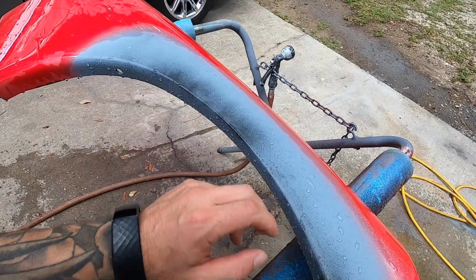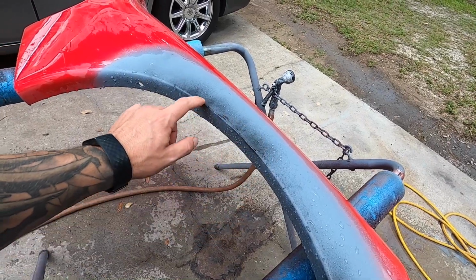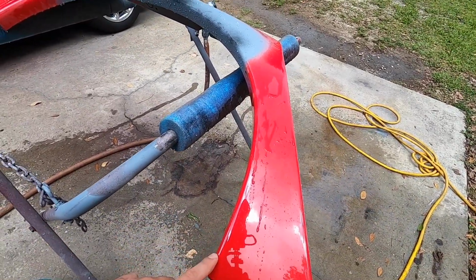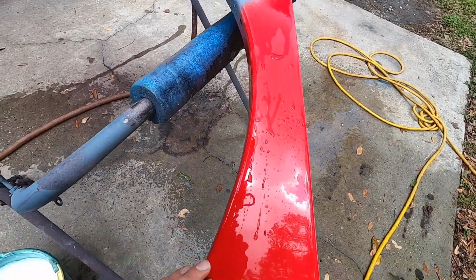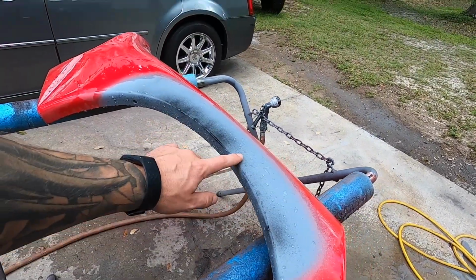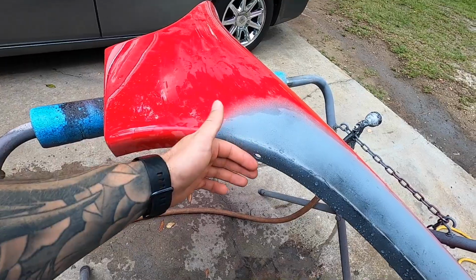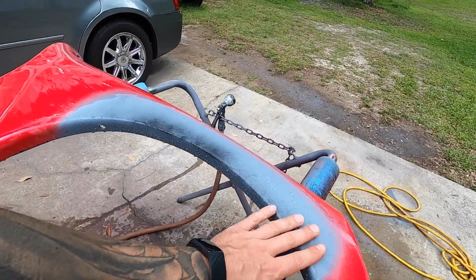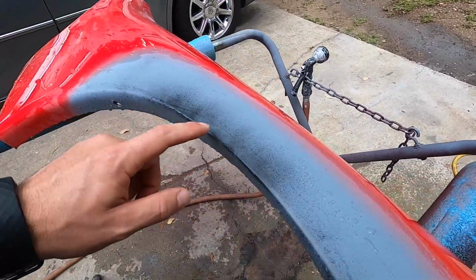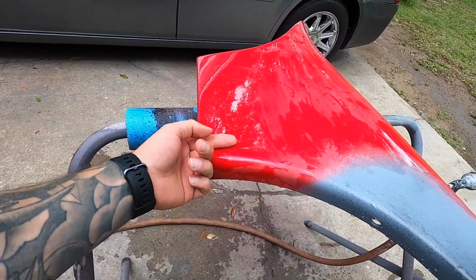It was actually on this fender, where we did the repair in the middle, it just was a little more squared off than we wanted. So he already fixed that, corrected it. Because if you look at these lines, the way they work is it goes from a round 90 degree, and then it goes more squared off as it gets to the arch. But then as it gets into the back here, it's really rounded off, this profile. So to correct these, it's been a lot of fun to try to make it the way it originally was. Like I said, at the top it has a much smaller radius, whereas over here you can see it's got this huge arch to it.